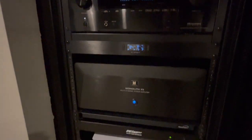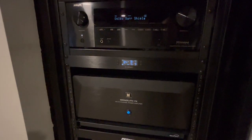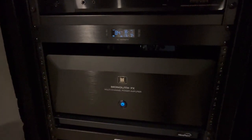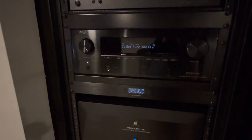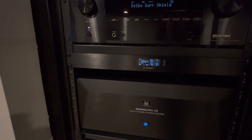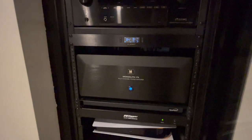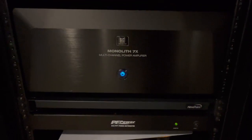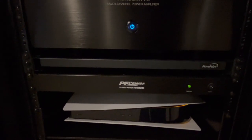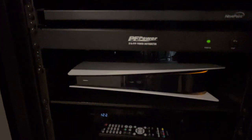Between the amplifier and the Denon you'll see an AC Infinity fan — it's a back exhaust fan. What I want to achieve is to blow the hot air rising from the amplifier away before it gets to the Denon AVR, so it's not heat-soaking the receiver. I've got it set to kick on at 85 degrees at fan speed one — real quiet, just blowing hot air away from the Denon. Just below the amplifier is the heavy-duty shelf holding it up, and underneath that is a power distribution strip — basically a power strip mounted to the rack to keep things neat.